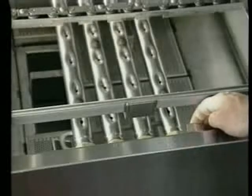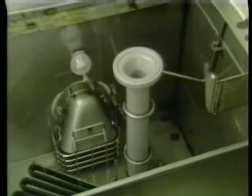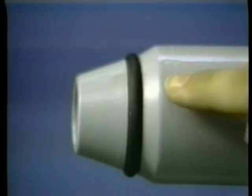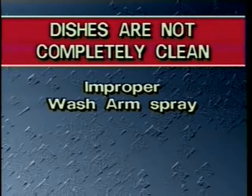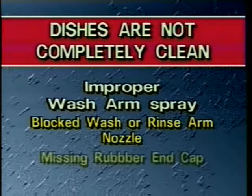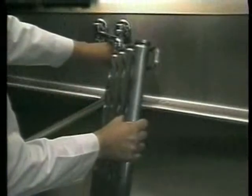Completely drain the tanks and check each drain opening as shown. However, when the tanks drain, the obstruction may be flushed down the drain and you may not find anything. Next, check that the O-ring on the drain plug is in place and not worn or torn. You must have an unblemished O-ring to maintain proper drain sealing. Refill the tanks and check your water levels again. If the tank water level is not the problem, you may not be getting proper spray patterns from the wash arms. An improper spray pattern could be caused by a blocked wash or rinse arm nozzle or a missing rubber end cap. If the rubber end cap is missing, replace it. If the wash arm nozzles are clogged, clean them using the removal and cleaning procedures described earlier in this program.